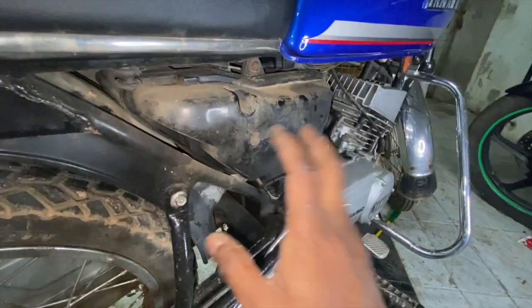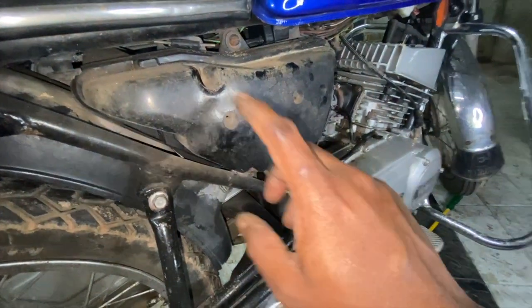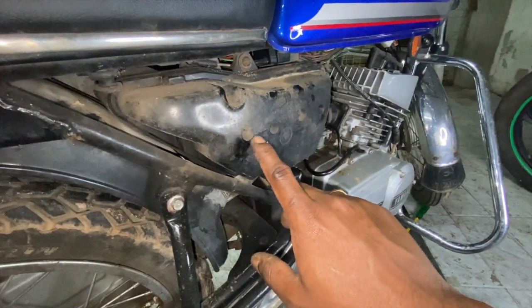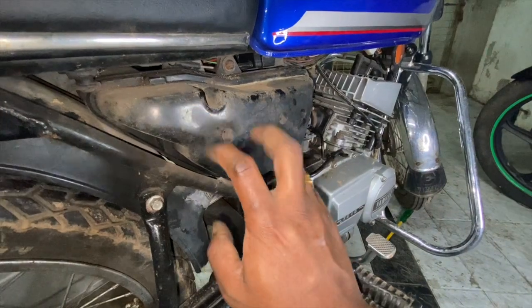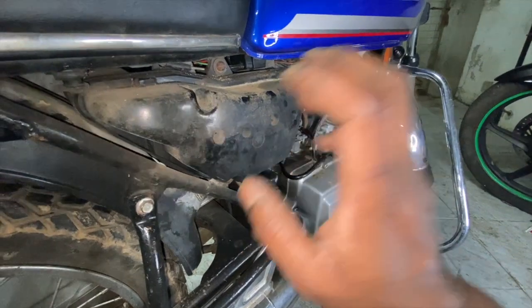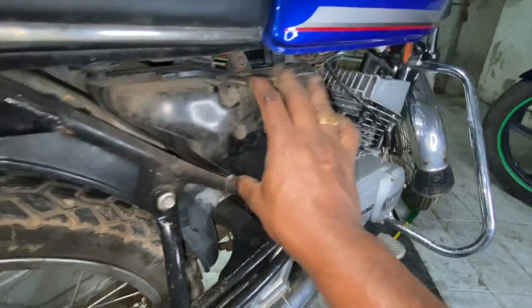Now let's talk about the air filter box. If you look at my bike, you can see there are a couple of holes here — I didn't drill these. This is a 1989 model bike, and at that time mechanics would drill holes to get better throttle response. That does pull more air and makes the engine run a little lean, though it improves throttle response to an extent. If you have these modifications, I would suggest you close these holes or buy a new lid, which is available in shops these days or used.